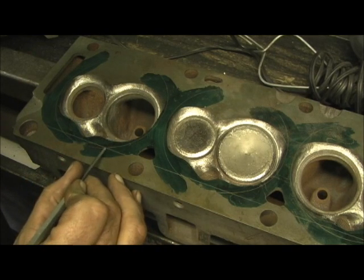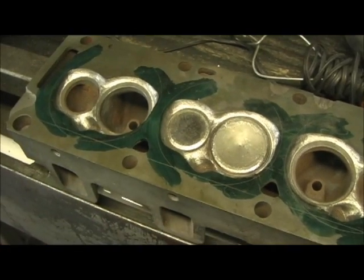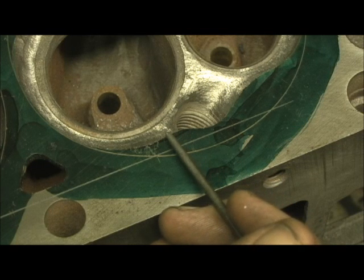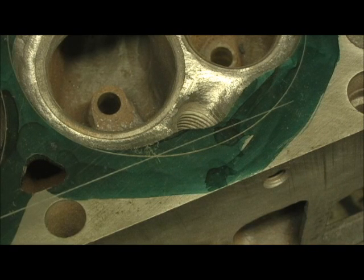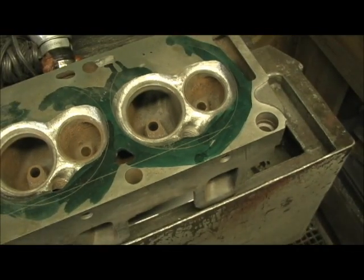There's the intake where we're unshrouding it. I'd be looking at this point to pull the curve in. That's one that's untouched — I'm still off a little coming over here, but I'm pretty close. All I'm going to do is take and pull that little lip down with the grinder and roll it right in to the intersect point right here where the chamber is. That's going to guarantee me a great unshroud, a little bit of hook, and they're all going to be consistent going off that line. That's just one little piece of it. There's one particular knucklehead out there that still believes that by twisting the gas around in circles it works — I'm not going to call any names. Anyway, that's all for right now on that chamber.